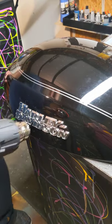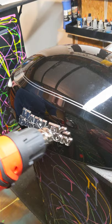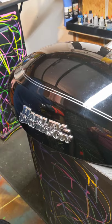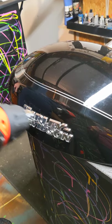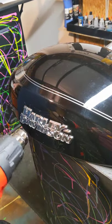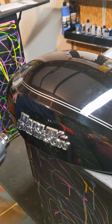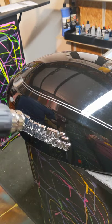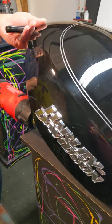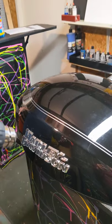Okay, so there are a couple of things I want you to remember. Remember the tools I used — I'm only using the spatula or putty knife and the heat gun to take it off. Also remember about thermoset versus thermoplastics. And remember what the painters always say: cleanliness is next to godliness. Always keep your hands clean and your panel clean.